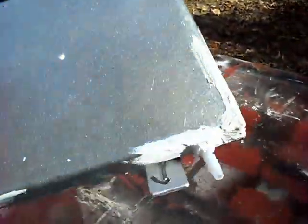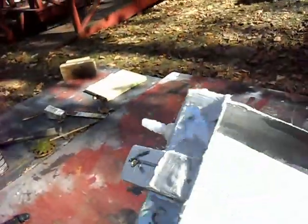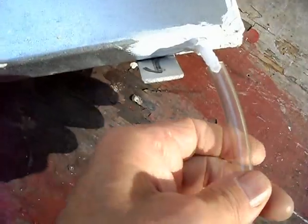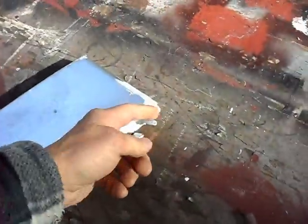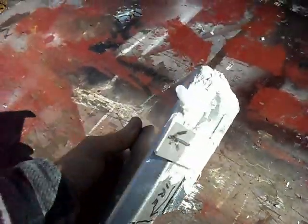This is what I did — you see that little plastic thing with the burrs on it? That's something I bought at the hardware store and siliconed it in, so now there's a drain here. You can actually see the hole — it takes a quarter-inch piece of tubing, and it'll go like this. That sits up under the dash, and this hose will come straight down along the firewall to the floor. Because I had to add this today and put silicone in there, we have to wait another 24 hours for the silicone to set — that's what's holding up the overall project.